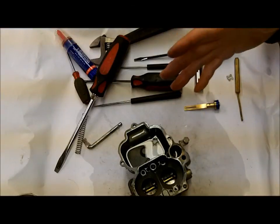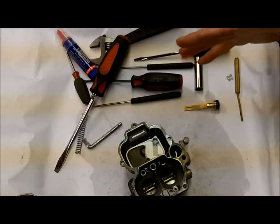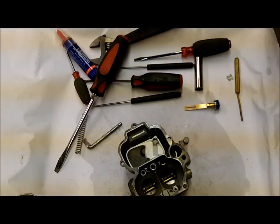I've verified that works — that's the accelerator pump circuit. Like I say, that can cause a lot of weird problems, so be sure that works before you put it back together. Thank you.